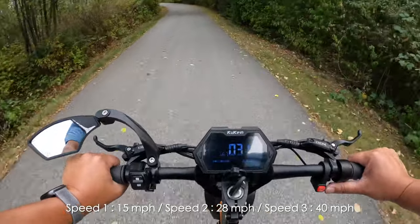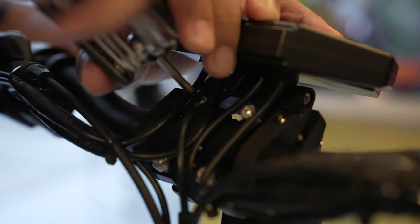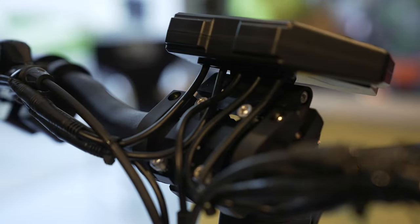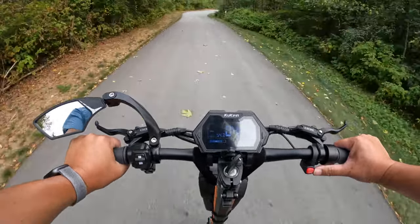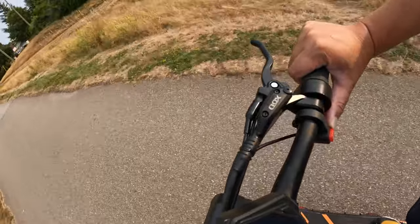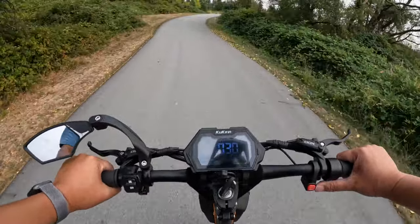When you get your G3 Pro out of the box and get the handlebars all set up, I recommend you go over every bolt. It does come with a little toolkit — just make sure everything's tight. I had a few screws that were a little loose on the rear motor, and I noticed a clicking sound; I tightened those up and that seemed to cure it. And for something going this fast, you really want to make sure everything is tight. One nice thing — this display I can actually see quite well even with the sun right now, and I can tilt it. It is way more legible than a lot of other scooters I've ridden.